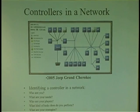So understand that if you have a problem where you can't communicate and you want to validate whether it's your tool or not, go out on the network, and let's say your tool has a list of, let's say, 10 computers you can access. Go to each one of these computers and write down codes on them, because if you have a lot of computers going U code, can't talk to the ECM, and another one, U code, can't talk to ECM, ECM failure, then you know that they have the same problem as your tool.